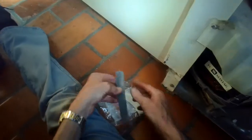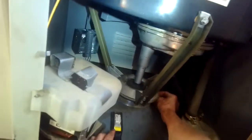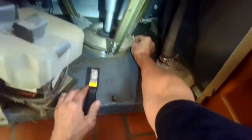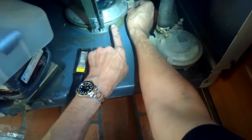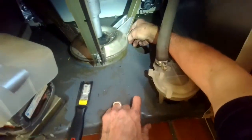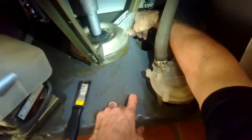There's the old damper pad — it's just a piece of felt. There's the new one. The kit comes with three damper pads and also three vials of lubricant. Now I'm doing the damper pad in the back on the right-hand side. Again, be really careful that the metal doesn't cut you — it might be good to wear gloves.